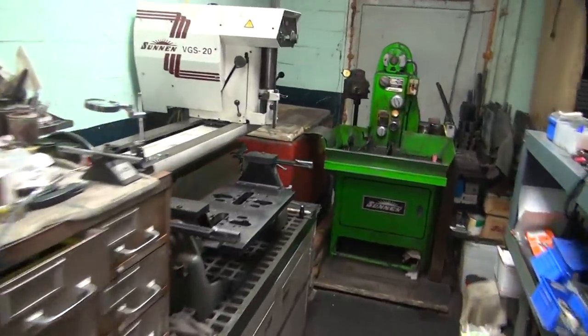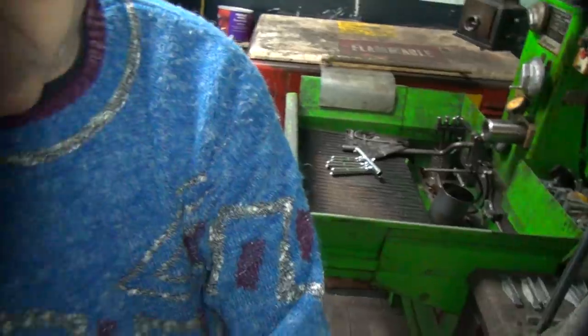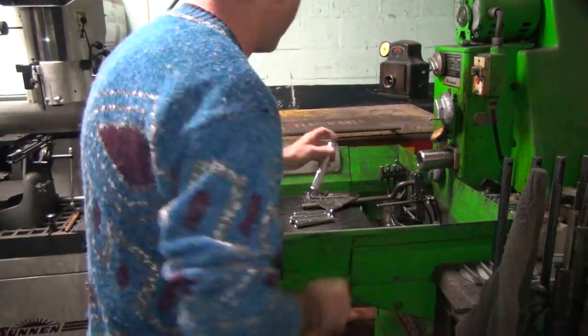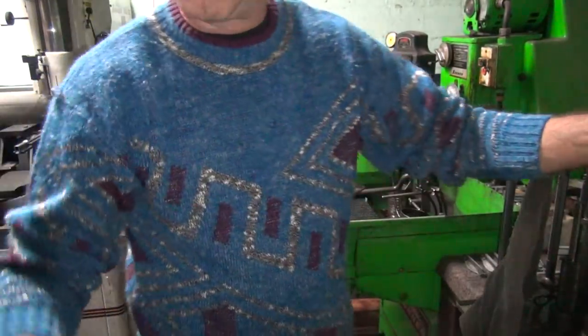So much for S&S quality control. I'm gonna do a little honing action over here now. The quality control sucks. This one has a burr. You feel this one? Right now, I didn't feel it. Well, I'll take a file to it. A fine file right over there.